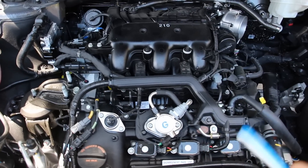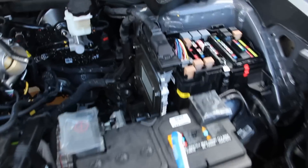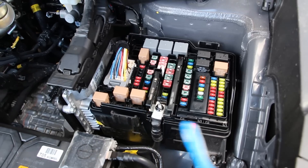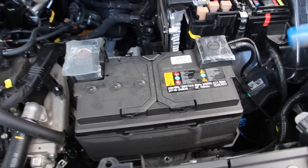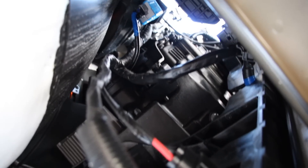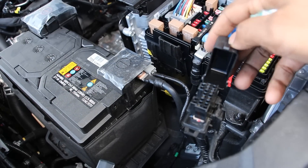In terms of electronics complexity under the hood, there's nothing really extravagant for this type of vehicle. You've got your normal wiring harness sprawled across the top of the engine, a smaller computer module located over here, and the main ECU located over here. I like that it is set back a little bit from the crumple zone, so it's not the first thing to get damaged in a fender bender. Over here you've got a nicely laid out fuse box, even labeled, and these appear to be pre-wired for a trailer kit even though this one does not have a towing package. The battery is right up at the front, nice and centered, easy to swap out — not buried in the fender somewhere. Despite the unique styling and placement of the headlights down inside the bumper, it's actually pretty easy to get to the headlight bulbs. The headlight assembly is a pretty big unit with heat sinks on the back to cool off the LED drivers — although you probably won't be changing LED bulbs and would have to change the whole assembly if anything's wrong.